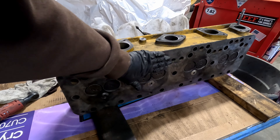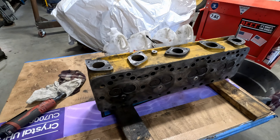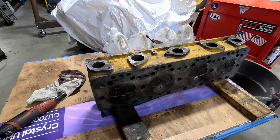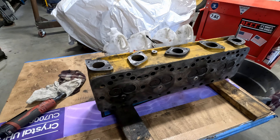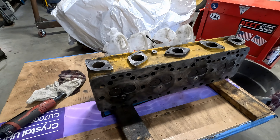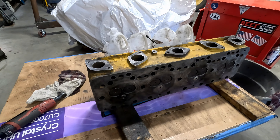Dad's cleaning out the holes on here, and it's been a long time since we worked on this head. Excluding the combustion chambers that we repaired and replaced, this head's been sitting on a shelf. This was our go/no-go with this project - if we could get the head fixed, we'd continue. We took it up to Antique Crawler Parts, had to get a couple of new used valves, he ground them and put them in, pre-lubed everything. It's been sitting on a shelf but now we need to get it installed.